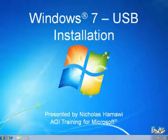In this screencast, I'm going to show you how to prepare a USB key for use as a Windows 7 installation source. Due to their small size, ease of use, and fast read rates, USB keys are very convenient for a quick installation compared to carrying around a DVD. This method is especially convenient in smaller network environments where you have a few computers to upgrade, but not quite enough computers to justify setting up a PXE boot server and Windows Deployment Services.